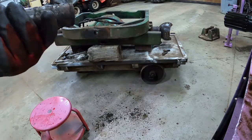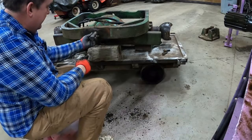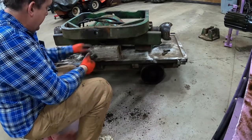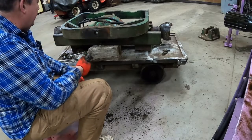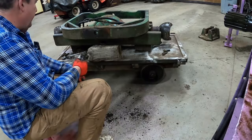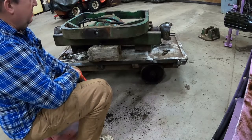The pin seems to be in good shape. There's actually some bushing left in there and it seems to be tight to the housing, so a new bushing is probably going to take care of that one. That's good. The back one - maybe not quite so much.